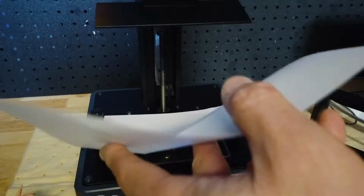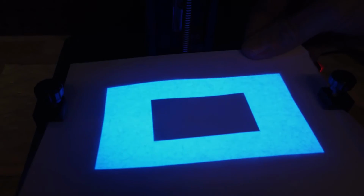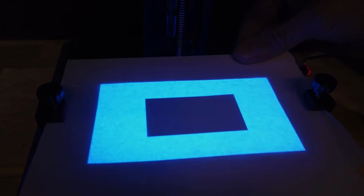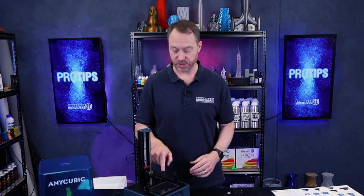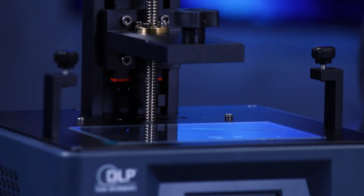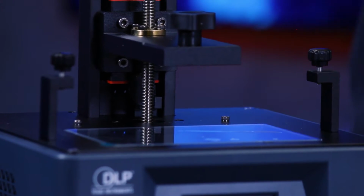They're considered to be better quality and sharper detail because you're not restricted by the pixel dimensions of the screen. And obviously you're restricted by the pixel dimensions of the projector module, but in a lot of cases they're going to be higher, better resolution. So this one, for example, is 720, which is just HD. It was kind of like the first HD that came out before 1080p.